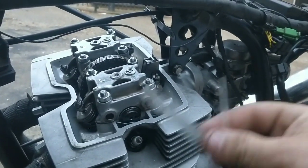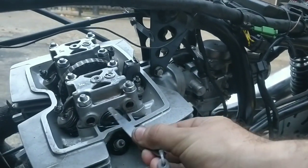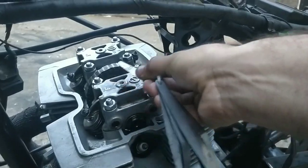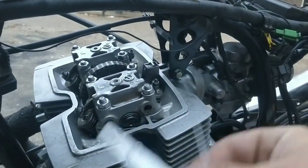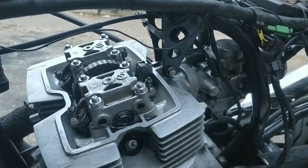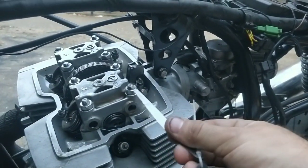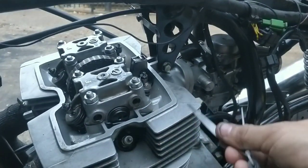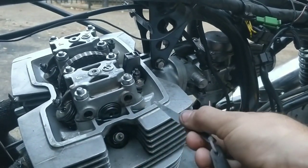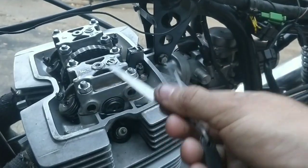Tomorrow I'll run this engine and do the new compression test. I think it will be quiet as anything. It's jetted appropriately for the cone. I am going to order this new bushing because I just don't want anything going wrong at this stage, and I'm going to put some Loctite on the nut there — maybe even on the top nuts. This top end rebuild is done. The only slight concern now is that with these set correctly, we might get more smoke, because it may have all gone back to perfectly timed and be letting through a bit more oil. If that's the case, this needs new valves — probably needs a new block too, because I'd have to send it off to get the valve guides done. You can actually just buy the block with the valves and everything ready to go.